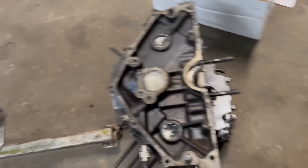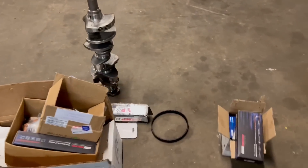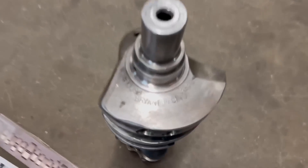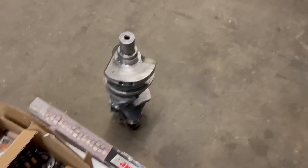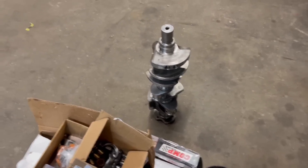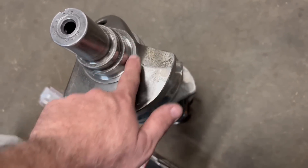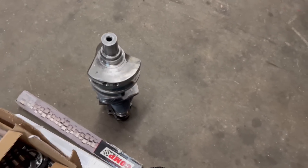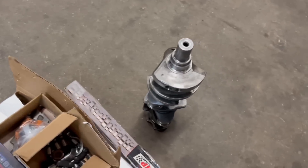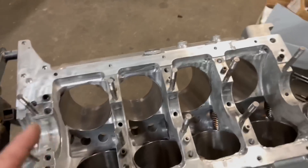We are still going to use the spacer bearings. This one is a 400 main just like the other one, so my crankshaft is still a 350 main. That's one of the things I might upgrade at some point. Maybe I'll call Shaft Tech and see if they can potentially weld these journals up, take them to 400, machine them back down, and re-notch them. But for the meantime, we're putting it back together exactly like it was.